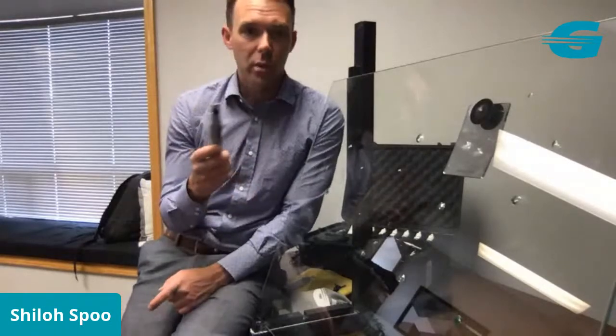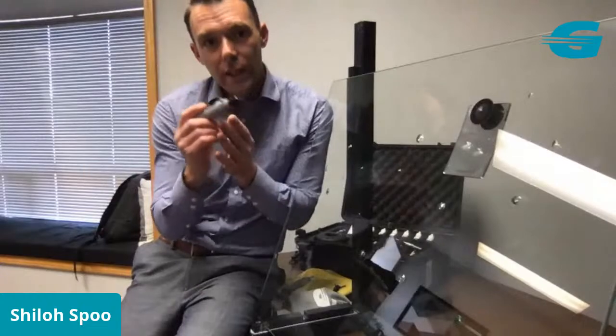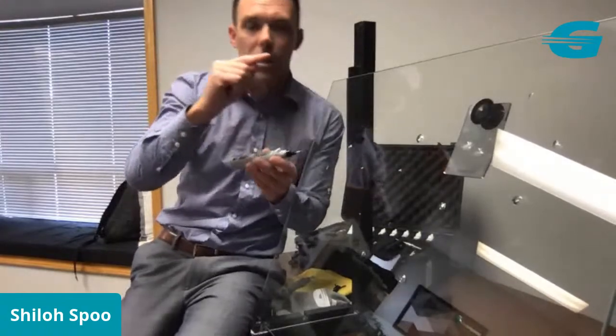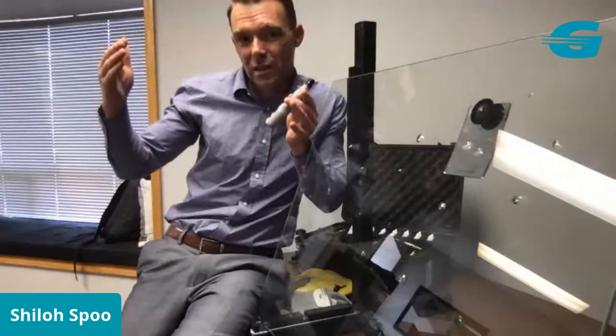So if you prefer to drill to speed up your repairs, just my suggestion, come in at an angle, kind of clean out the pit a little bit. If you go deeper into the repair, don't leave one straight bore hole through it. The deeper you go, the wider you have to go, so there's a slow taper towards the base of where you end up.